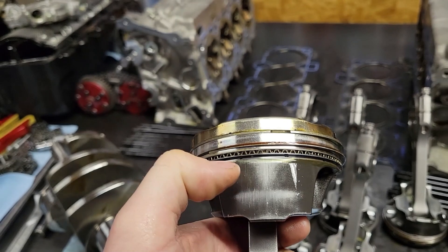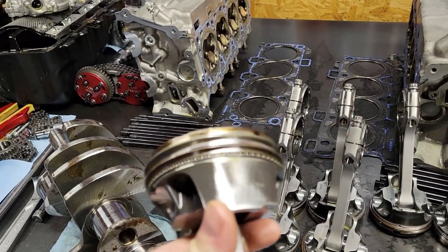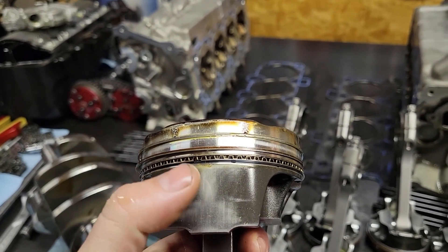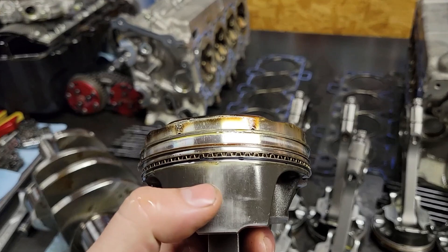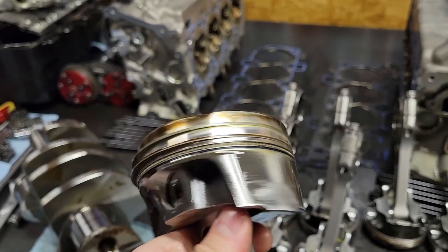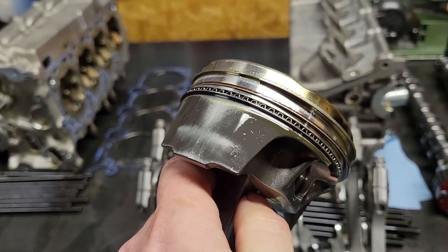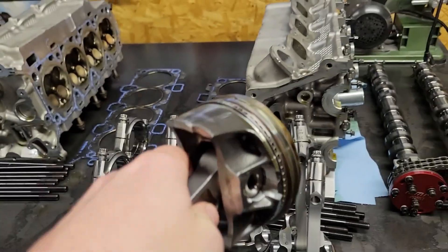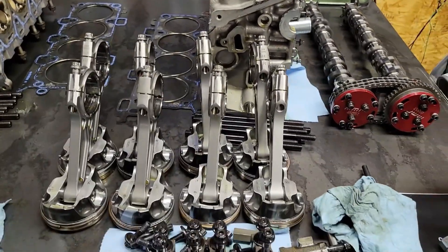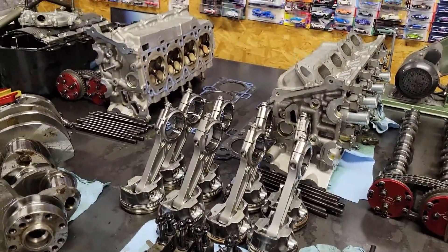You can still see the top of the wear pattern up where my thumb is — it's wider there, but that force should be spread out down lower. I'm going to agree there is a design problem here. The thrust side shows a slightly wider pattern because it's getting loaded more and deforming the skirt a bit, but it just doesn't have enough barrel shape to the skirt — it needs more area there. The bottom wear line is where the skirt exits the bore at the bottom of travel. We're going to have to do something different with pistons — might move to Wiseco, or talk to Diamond about what they think.